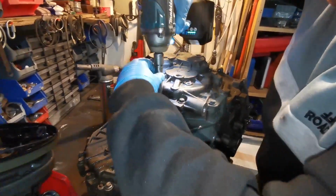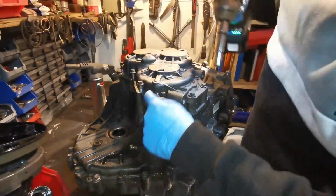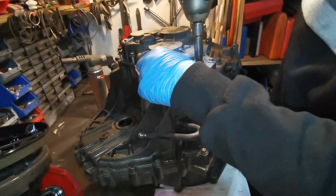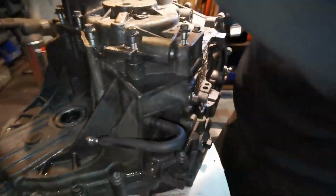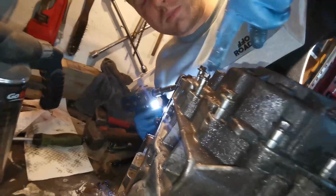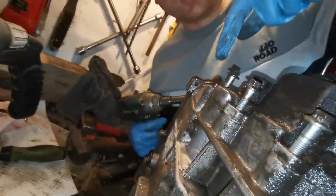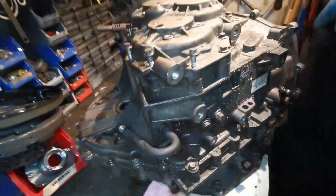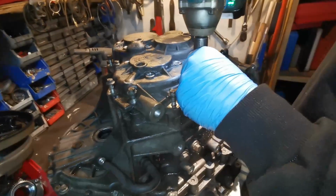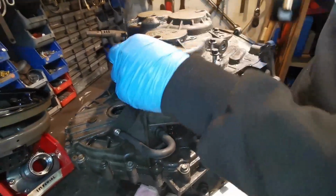There's no gasket. They're meant to be locating lugs, or whatever, these pins. So it's leaking right here, because the bolt's here, then there's a lug, and then there's a bolt there. So it needs more gunk next time. I think we'll have to put some sealing gasket.